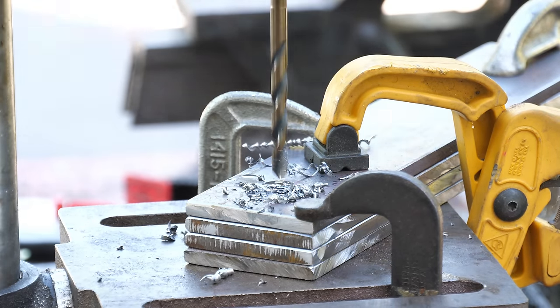With that slid all the way into the muffler, it's clear that the pipe is still a little on the long side. I don't think we could actually get a collector gasket in there, but it's close enough to call this a successful test fit and move over to the driver's side. Which, after some trimming, checking, and more trimming, seems to fit nicely.